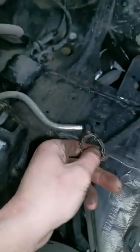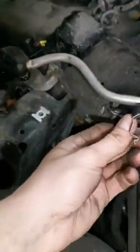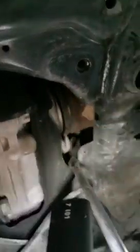What I'm gonna do is take a zip tie and tie this level sensor, since I'm alone here. I'll put a zip tie around here so I don't break anything — you don't wanna make more damage than you earn. Put the zip tie inside. Now you're safe to proceed. I use a big flat blade screwdriver and gently pry it out — it should go fairly easily on these new cars.